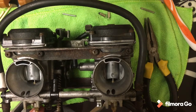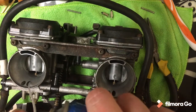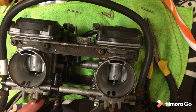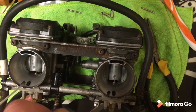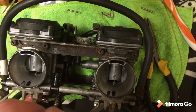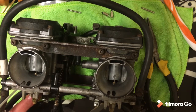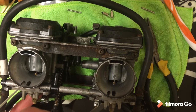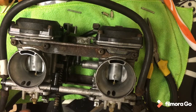Just giving it a bit of a clean-out while I'm here. It's coming out quite nicely — that's the main jet, and the fact that it's all pouring out of that end means that must be the pilot jet. That's wet — yeah it's coming out fine. Main jet — oh yes, it's coming out. No wait — I'm holding it flat so it's not getting any air through it. Right, happy — got that cleared out.